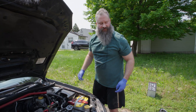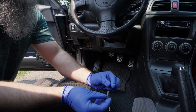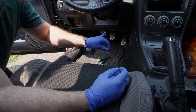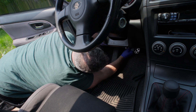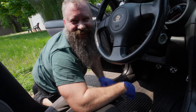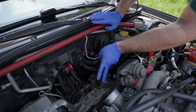Let's go back in the car. We just need to reconnect that. So then you'll put your new one onto the clutch, put the pin through and then put this through it so it'll lock it. There's no pressure, but there's no fluid — good. We're done in here. So we have the master in, we connected it inside with the clutch, we connected these two bolts. So now let's put in the slave.